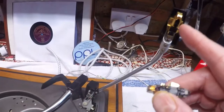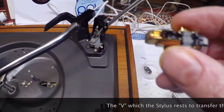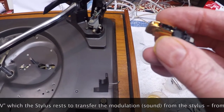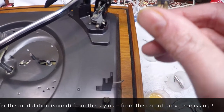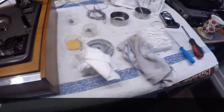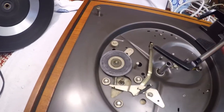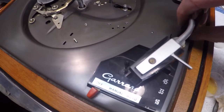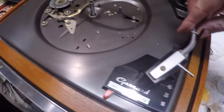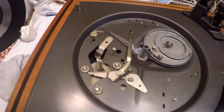The two little places that pick up the sound from the stylus itself - let me get the spare I fortuitously have here. You can see the little thing at the end where the sound is connected is not present on that one, so it won't work - I think it's snapped off, they look quite fragile. The back end comes off and you slot in the other one from the wiring, so I won't have to change the wiring at all. I'll do that at a later stage. There'll be no sound coming through the amplifier because it wasn't picking anything up. I've taken the stylus out and I'm cleaning the rest now.